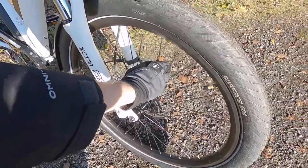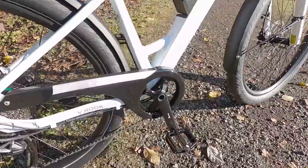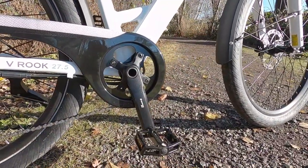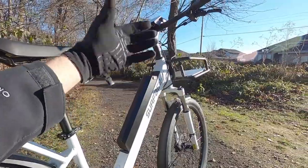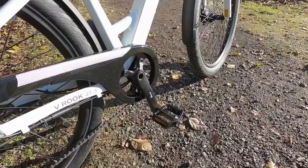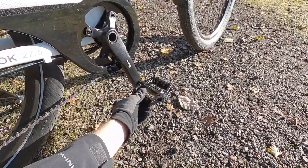They sort of mount under the fender. You also see that the hub is black, the thicker 13 gauge spokes are black, and the rim is a little bit wider. This is a Samox sturdy hollow spindle at the bottom bracket, so it's a little bit of an upgraded part. These are sealed bearings for the bottom bracket and the headset — that's straight inch and an eighth. Down here these are 170 millimeter standard length crank arms with Welgo name brand platform pedals.